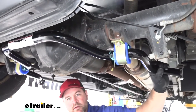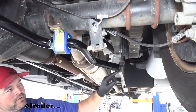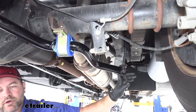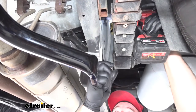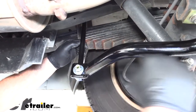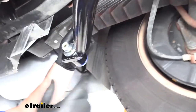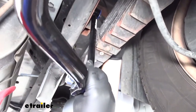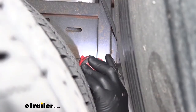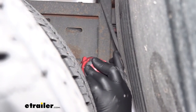One thing you're going to notice is that where our end links met our original bar, they're in a different location. So we're going to put on our new end links, mark on the frame rail, and then drill a hole for our new hardware. We'll take our 5/8 socket and remove our factory end links. With our sway bar sitting level with the ground, we put on our end link and make sure it is vertical, then mark the inside of it right on the frame rail and drill a hole. Make sure you check the inside of the frame rail before you drill all the way through to ensure there's no wiring or anything you may have to move.